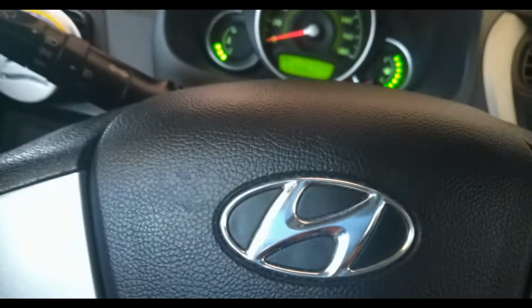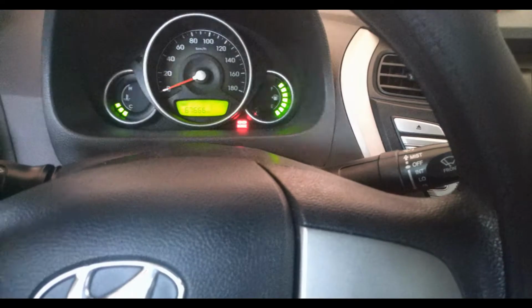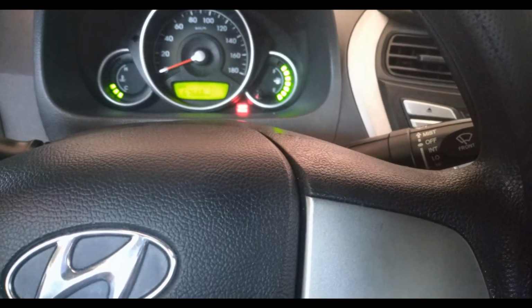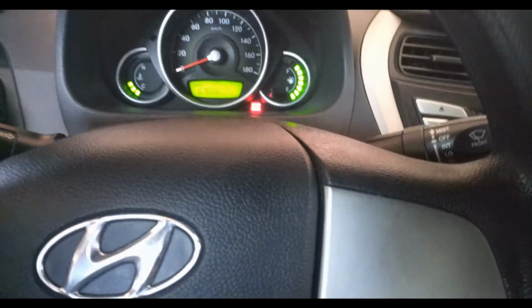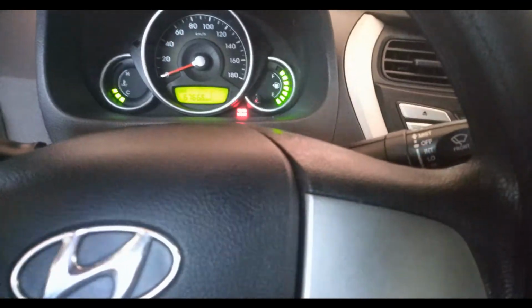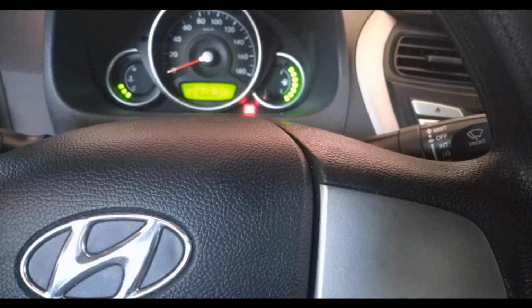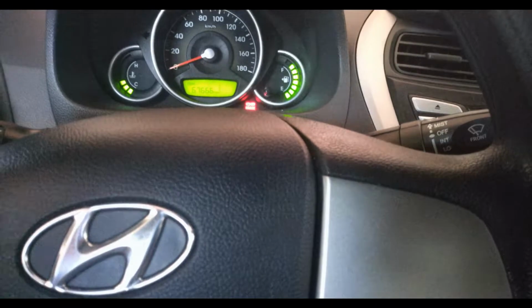All right. So while inside, let's go ahead. Just a quick review. We've already checked the battery, the oil, the lights, and the next thing that we will check would be our brakes. Okay. First thing that we want to do is visually inspect your brakes for any lines on your disc rotor. That's actually a bad sign. And then next would be the level of your brake fluid. So let's go outside and check it real quick.